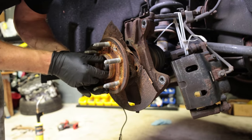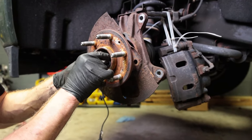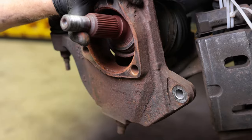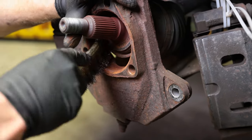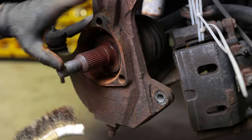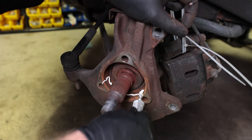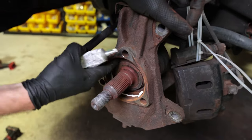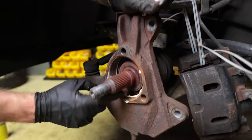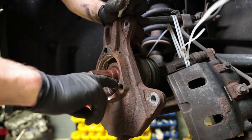Alright, we got her — still much easier than Pete's truck. I'm going to undo the nut at this point. Now there is a washer in here which you do need to reuse if you're not replacing it — I'm just reusing the washer. Now I'm just going to clean this surface up a little bit, be careful of your axle while you're doing this, especially the dust boot — you don't want to puncture it with any brushes. I'm just adding a little white lithium grease in here; it stays off corrosion for a little while.